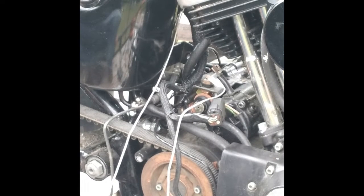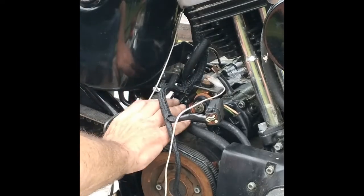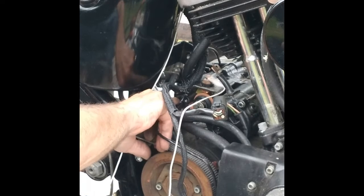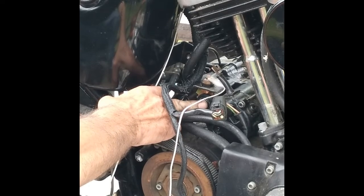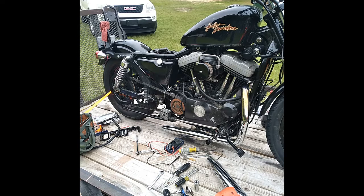That's a hell of a lot better than 2,500. Let's see if this thing will turn over. I had to move this one here, loosen that one. The only one that was way off was this bottom one where the battery cable goes in. I loosened that one off and it went from 2,500 to 800 — just by loosening it and holding the piston in there, kind of aligning them up while tightening. Got it down to 2.5 ohms instead of 2,500.